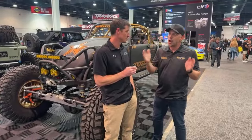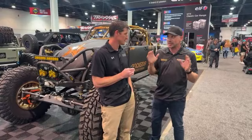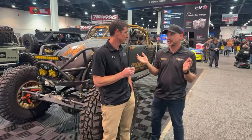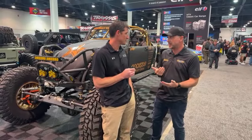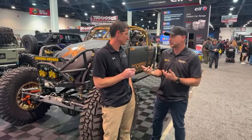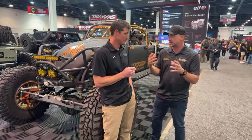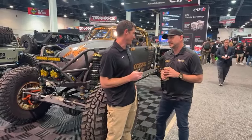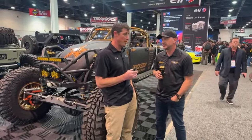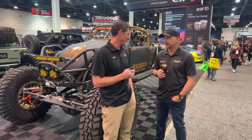Spools are always on. You can't turn them off. There's no disconnect. Once it's all bolted in, it isn't changing until you take it out. That's why you're not typically going to break it, because it's always engaged. Also, it's a one-piece design where there are no secondary parts that can fail. Yep. You could rip an airline off, your air compressor breaks, or if you're running off a tank, you run out of air and you're 15 hours from home and really upset, you're open.